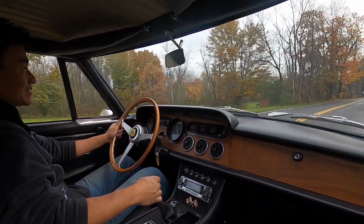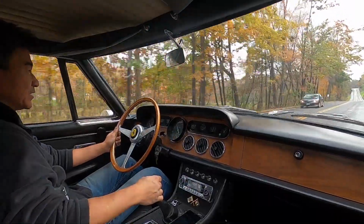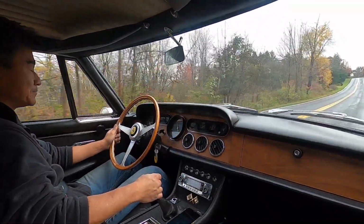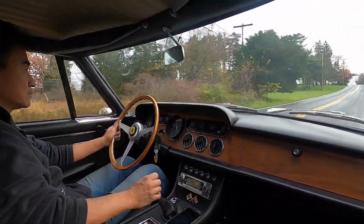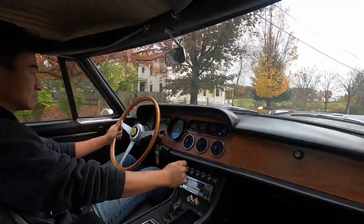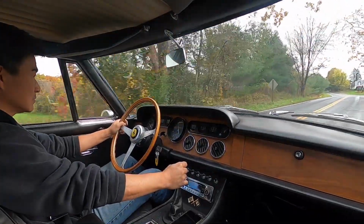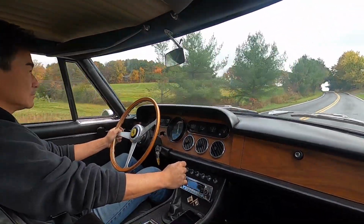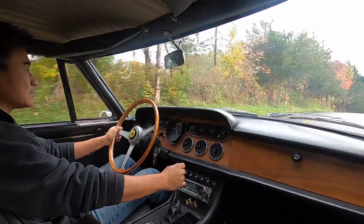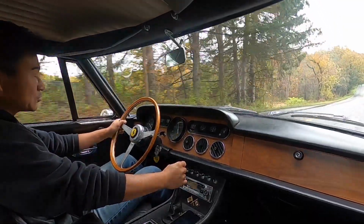Oh, I can also smell the gas in this car. It's super old. So sometimes when you tune these carburetors, you're chasing your tail until you get rid of some of this bad gas. Yeah, you can hear it just snapping away. Yep, you definitely hear that snapping and popping. Check it when we get back. Probably just the mixture screws need to come out a little bit.